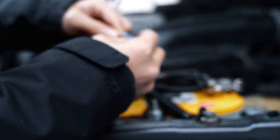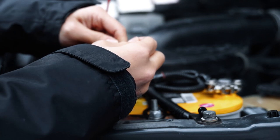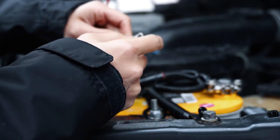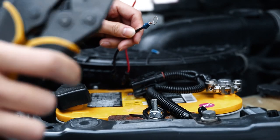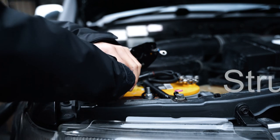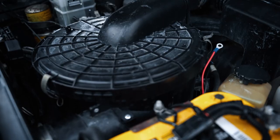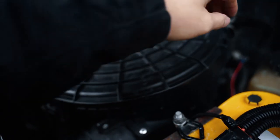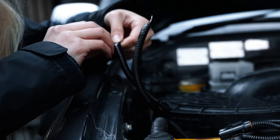On the battery side, we'll put on the two-way ring terminals. Make sure you see the wire coming through. Technically you should solder that side so it's secure. It's hard to make it look cleaner for protection inside the engine bay. The rest of the parts we split-tubed and mounted along this side, just zip-tied.